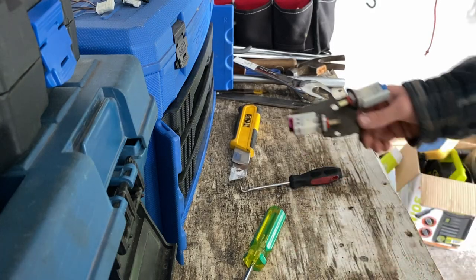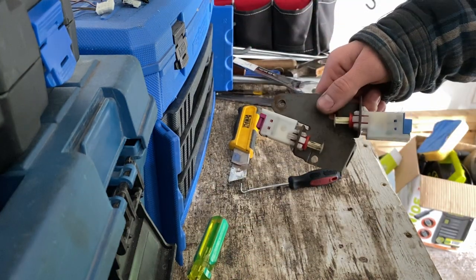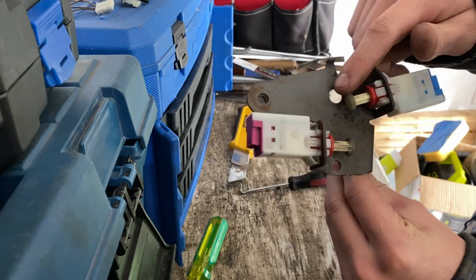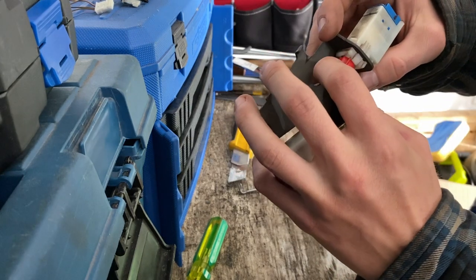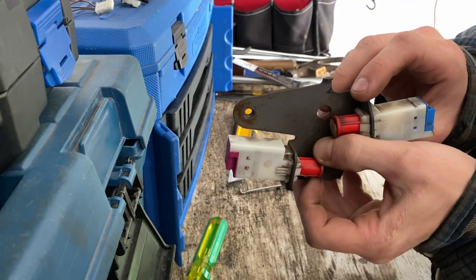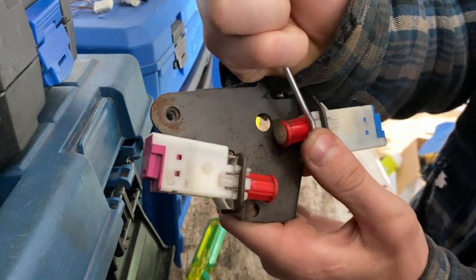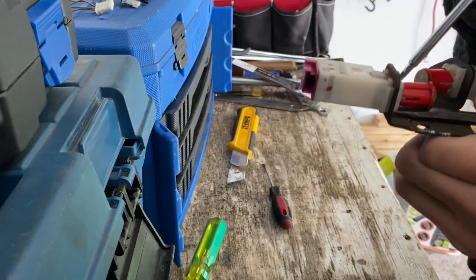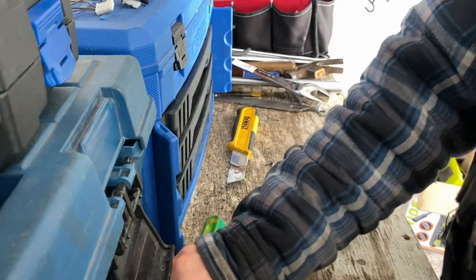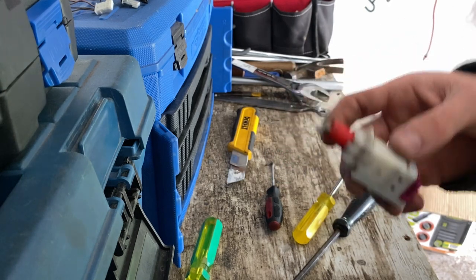For the clutch pedal wiring — I just picked this up from the junkyard this morning. If you're trying to change your switches from this bracket, what you're going to do is pull these red tabs out like that — very easy to do — and then you just push the triangles in on each side. That's one, so you guys get how it comes out. We're going to install it on our other bracket inside the car and I'm going to have to solder the wires.